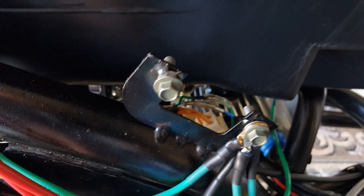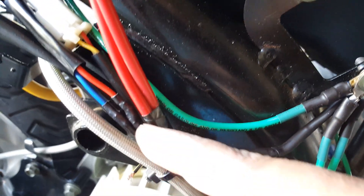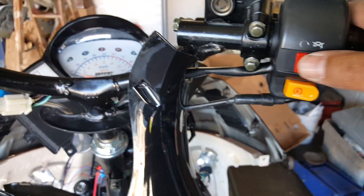Now we're going to fire the engine up. The RPM won't work until this is connected to our blue wire, or we can tap it from here since it's close by and will be permanently fixed. The black and white wire on this end goes to the blue and white wire at the stator — that's our pickup wire we need to tap back into our ignition coil wire. It shares with the same spark plug wire pickup to know when the spark plug fires with ignition. That's how it reads RPM — from the pulse of the ignition coil and spark plug revolutions per minute.